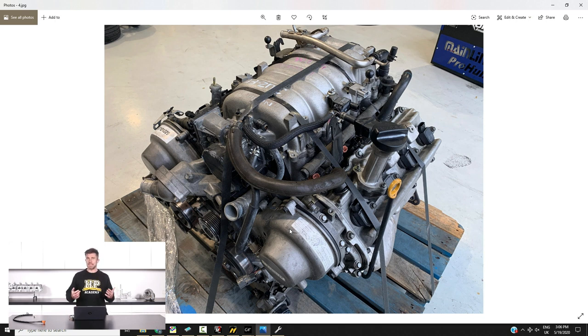The idea here is it doesn't need a lot of power. Depending on which generation of this particular engine — whether it's 1UZ or 3UZ — you're sort of somewhere around about the 300 horsepower vicinity, give or take. That's not really the key part we're chasing. What I want is something that's nice and tractable with a really wide torque curve. These also sound pretty good and are a pretty cost-effective engine. So that's what we're focusing on with the engine swap, along with modernising some of the other components on the truck.